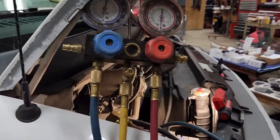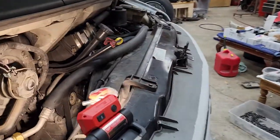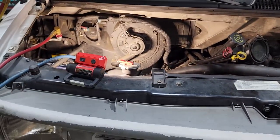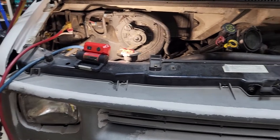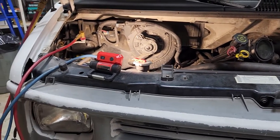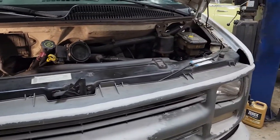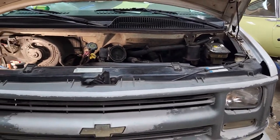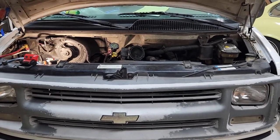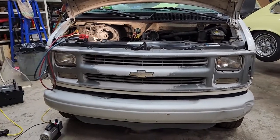It has held steady, so we're going to go ahead and put the water reservoir and the air filter back on. We'll turn the vacuum pump back on. It's about quarter till seven - let it vacuum down till about 7:30, then let it sit for about 15 minutes to see if it leaks. If it does not, we will go ahead and charge it up. If it holds tomorrow, I figure I'll probably save myself about $1,000 in labor. RV labor has gone to $160 an hour and mechanic labor was $130 an hour last I checked.